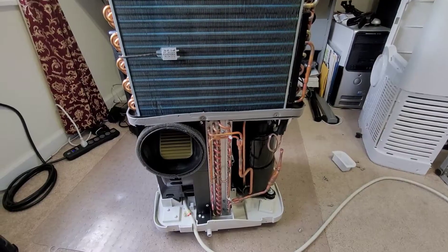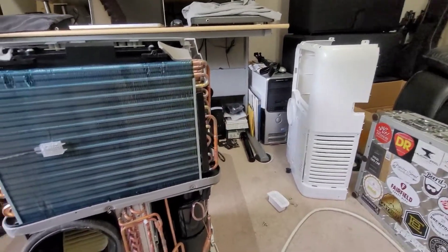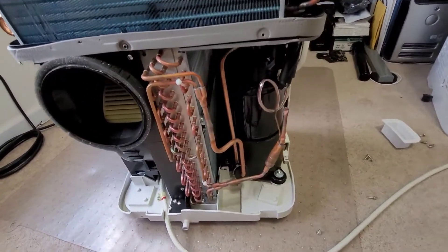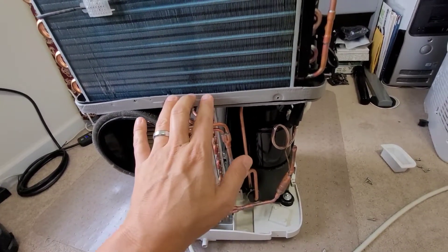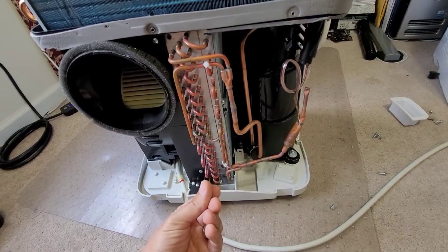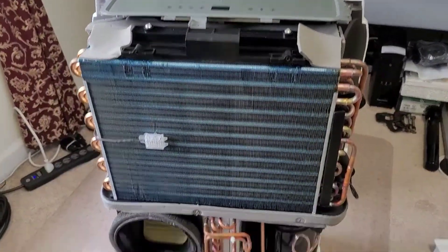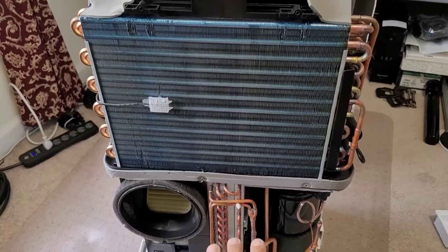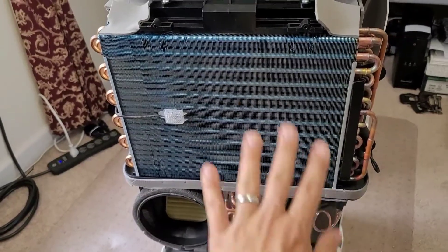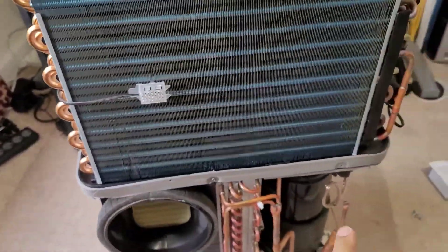The curiosity got the best of me. I decided to take this apart to really see how it's configured, and it's a little bit of work to get to this. The good thing is that the evaporator coil right here is sealed off from the condenser, with the exception that the condensate drain is not up here — they moved it down here, so there is a drain going right on top of the condenser, which is essentially evaporating all the moisture out and blowing it out the exhaust vent. That was done by design. I'm not going to worry too much about that because there's very little efficiency lost from air escaping between the condenser and evaporator sides. It's sealed off and we're good to go.